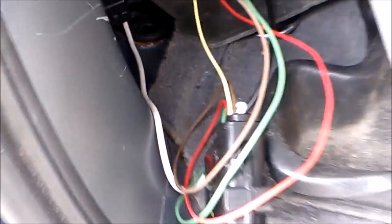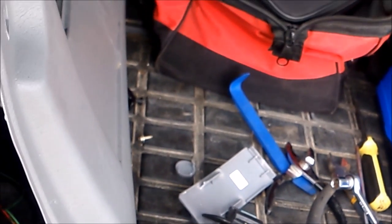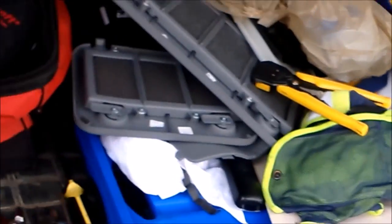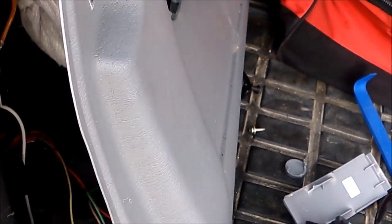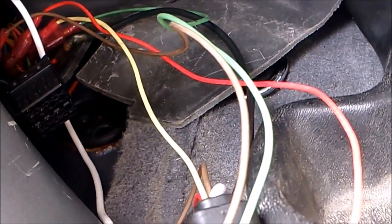Hopefully that helped somebody. You can — I've seen other videos on YouTube and I've done it myself before — splice onto the trailer wiring and run to the other side and hook up to the other wiring. But this is the wiring harness pre-provided for you, the one from the dealership. It's got left and right turns and everything all on one side of the car, so you don't have to take apart everything on both sides. All the power, everything is supplied right there and ready to go. Thanks for watching.